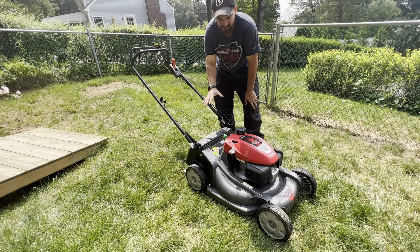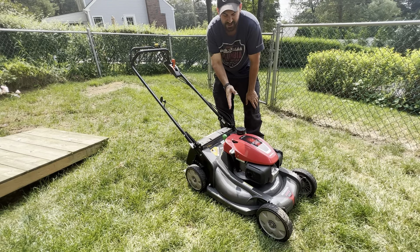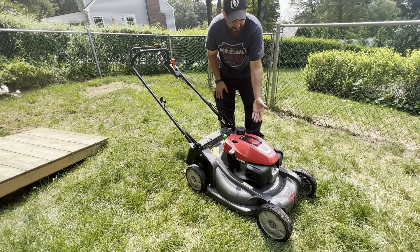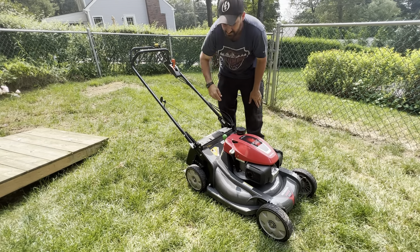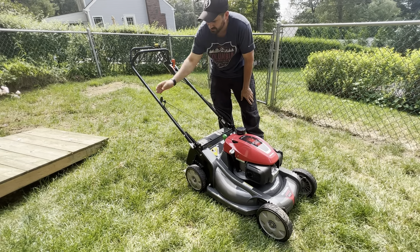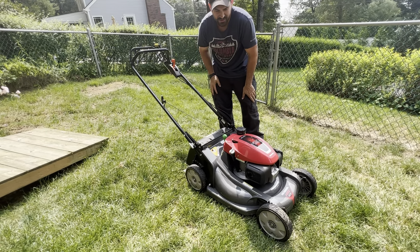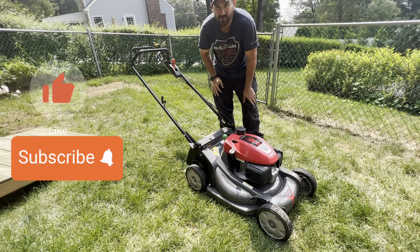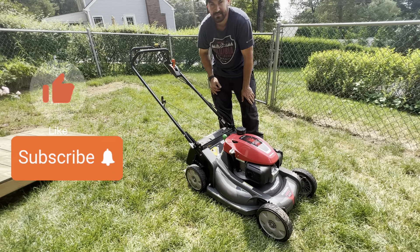It's just sad to see Honda going this way — they're known for easy start. It even says right here: 'Easy Start Auto Choke System.' That's what it should be known for — one pull every time. I've never had issues with Honda starting before; this is the first machine I've had starting issues with. The thermal wax was one thing, but now the camshaft on the new 2023 ones is another. Hope you enjoyed this video — let me know your thoughts in the comments. Did you buy one of these new mowers? Thanks, take care.